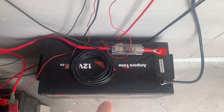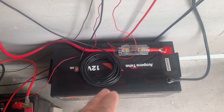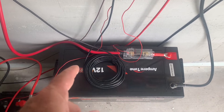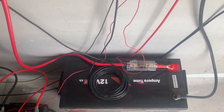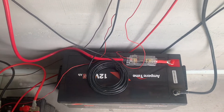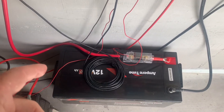From the shunt, that feeds down to the lithium battery, and this has a 100 amp BMS, which means it can only accept 100 amps going in and can only send out 100 amps. It does spike to around 280 amps based on tests I've seen, but normal use is around 100 amps.